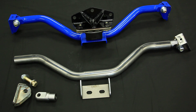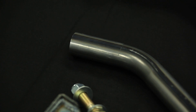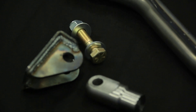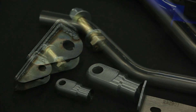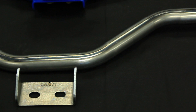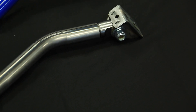This allows the ultimate in flexibility of the drivetrain. By rotating the one and a quarter inch diameter bent tube prior to installing the billet tube adapters, the drivetrain angle is fully adjustable with a maximum drop height of four inches. Plus, the weld-on brackets can be positioned as needed along the length of the factory frame rails to easily accommodate transmissions of different lengths.